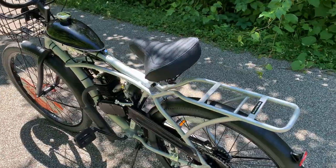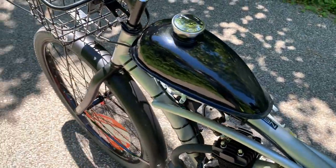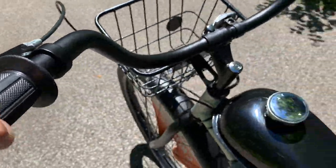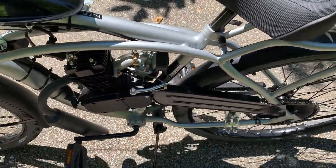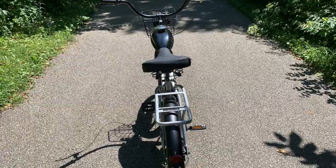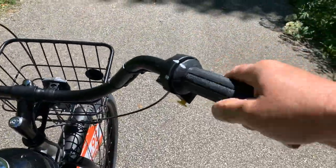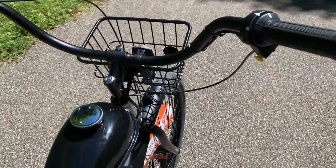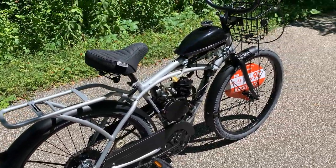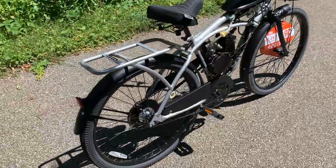Initially, we're going to pedal the bike about three bike lengths. You've probably noticed you cannot move the bicycle freely without applying your clutch lever. When you release the clutch lever, that engages the engine. When the bike initially starts, try to keep the revs down because everything is brand new. Don't crank the throttle wide open — keep it moderate and let the engine come into its own. It'll be a little chuggy since nothing is broken in yet, including the chain, sprockets, and internal parts. This is a mechanical break-in test ride.